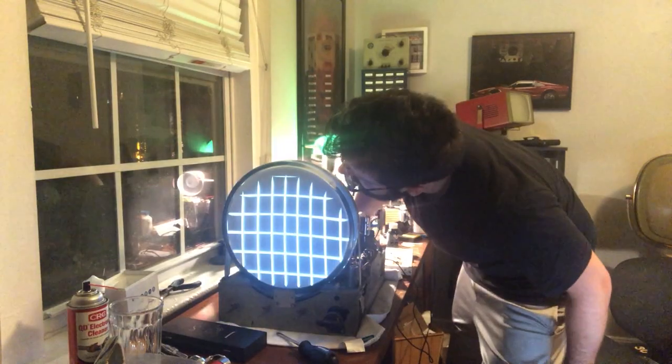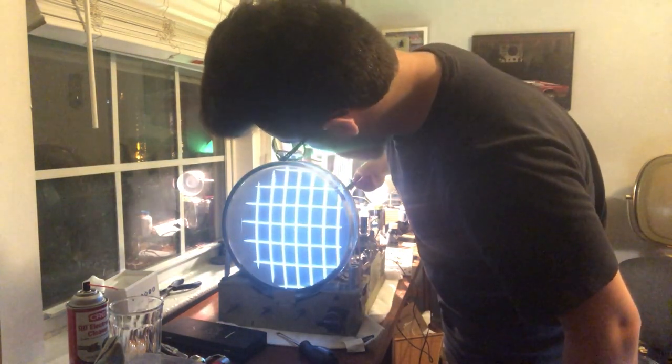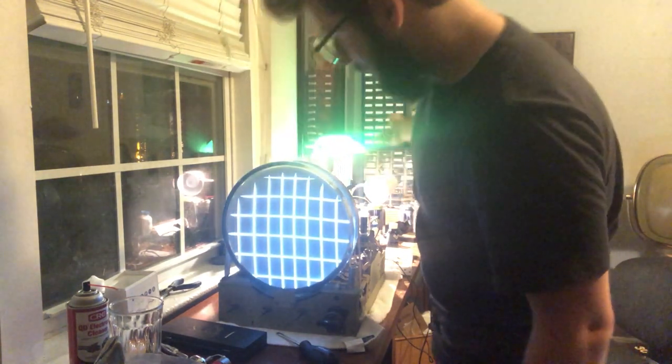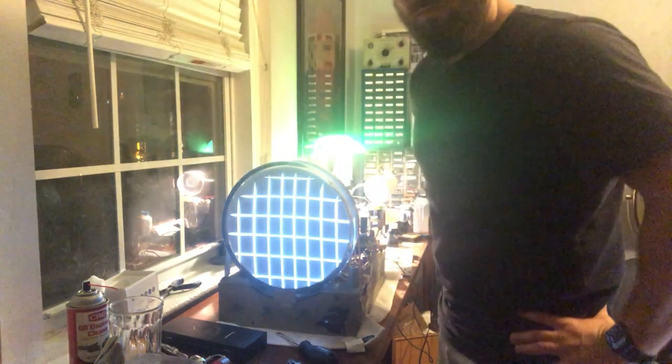Let me figure out where the width control is, because I could help out on that side. Both sides look pretty good. I'm going to work on the electron beam director a little more and see if I can work out that height — still getting a little cutoff at the top. Centering looks fine, but I'd like it to be a little better.